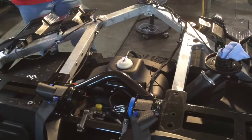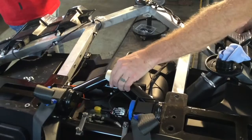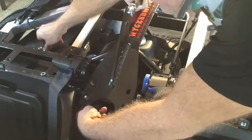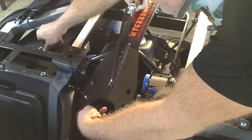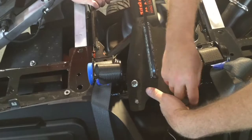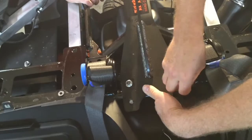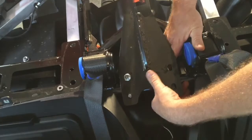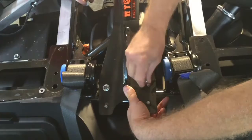Don't forget this wear ring — flip it in place. You don't want to be scratching that beautiful powder coat. It goes that way. It's going to slide the hitch in place. We're going to work on this side first, put one nut on loosely, then come over and get the other one in place. This is a tricky part — have someone here to help you. Take off that nut, slide it underneath. That hitch is going to slide down. Then he's just going to lift it out and put the other two nuts on.